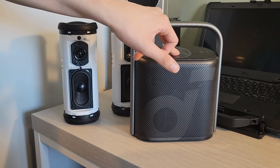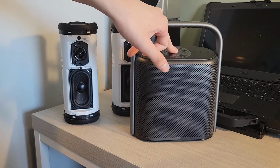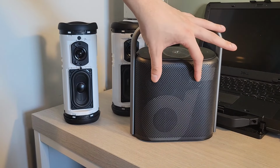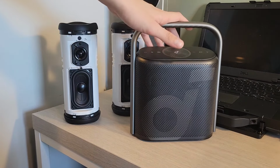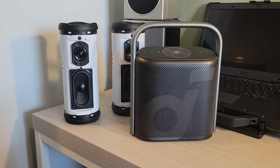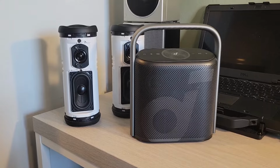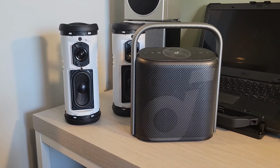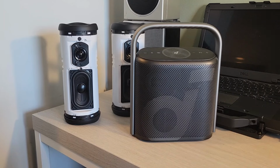This is a downmixed mono signal. And with some phase shift added to it at certain frequencies, it tricks you to feel as if the speaker is bigger. Same with the front drivers as well. They probably do a similar kind of a phase shifting to it. They might even add reverb or some delay between the top and the front drivers. So yeah, you're losing something actually. You're not gaining anything from having that extra spatial audio driver on top. Maybe just a little bit of a loudness, but I don't know. I mean, it's just stereo signal. You're not gonna get anything extra.